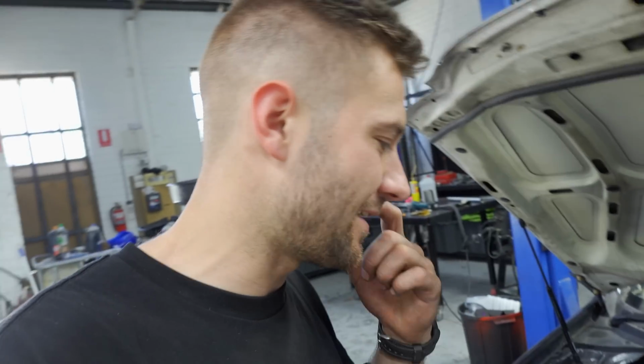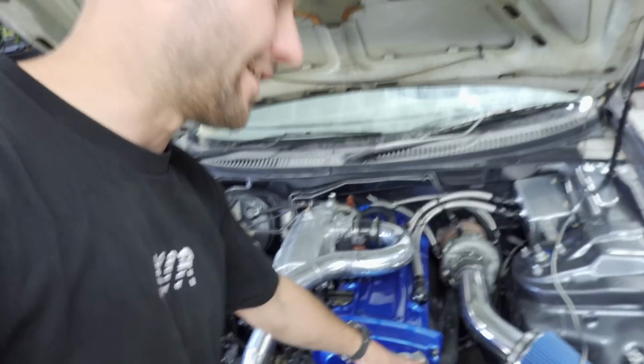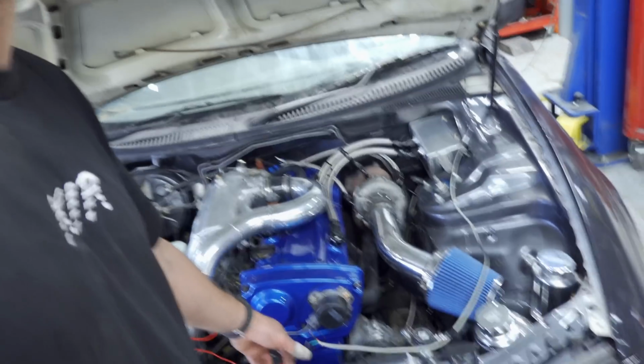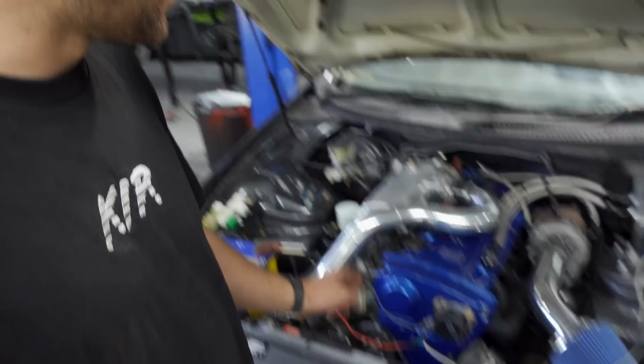Fortunately for us, Ross Performance, who are already supporting the build with the Gangster Balancer, are sending out the rest of the missing pieces to replace the crank angle sensor and have a Hall effect 24 tooth trigger. Replace that and put another sensor down on the balancer, because that balancer does have a trigger tooth wheel on it. So yeah, it's going to be pretty spicy. Running a sensor on the crank and the cam allows you to actually view any belt stretch as you start revving the car higher and making more power.